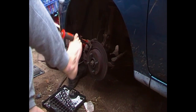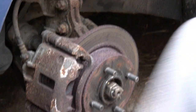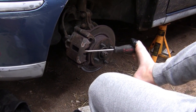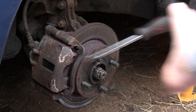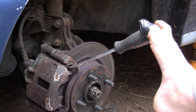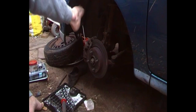It might work, might need a screwdriver in it. The brakes, to me, don't feel too bad. They're just a bit vague when they're rusted up. I always push the piston back a little bit just to loosen it off. I'm not putting a lot of force on it — it's just enough to make it easier to get the caliper off.